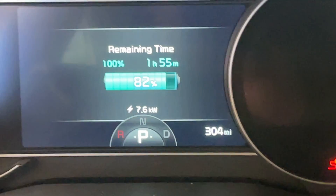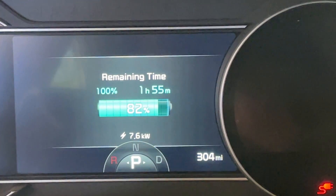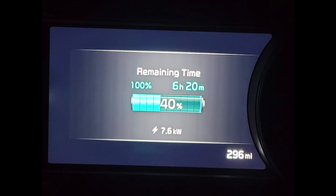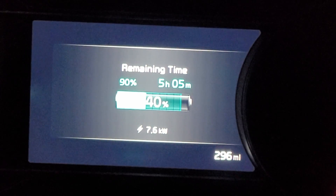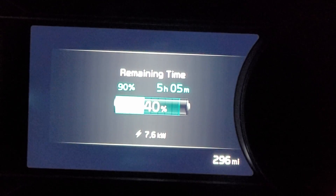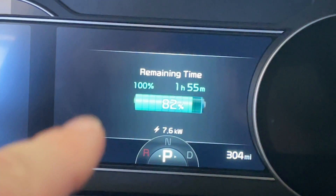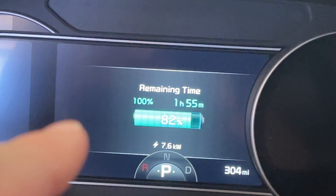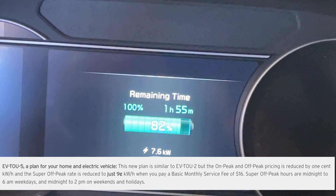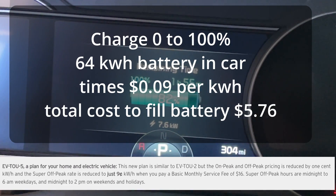So I'm at 82%, which means it's going to take about an hour and 55 minutes to go 18%. Just to let you know, going from 80 to 100 is a lot slower than going from zero to 80%. I had it at about 40% last night — going from 40 to 100 was about six and a half hours. From 40% to 90% was taking about five hours. If you're at zero and want to go to 100, you're probably looking at eight or nine hours depending on how big your battery is. This is a 64 kilowatt hour battery. This is great overnight charging — go to bed, charge up, especially if the rates are inexpensive. I just signed up for a rate with San Diego Gas and Electric, and from midnight to 6am I pay nine cents per kilowatt hour, so it'll cost me basically nothing to charge this.